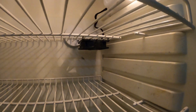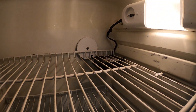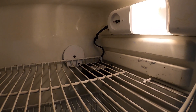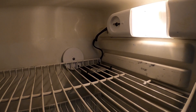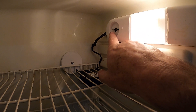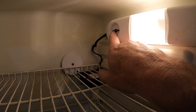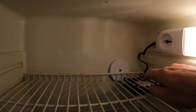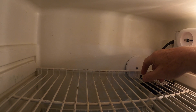I've also got a little circulation fan in there which helps stop ice build-up on the back wall. The temperature sensor for the electronic controller is sitting here, so as mentioned it measures the air temperature inside the fridge, whereas the original thermostat was actually measuring the back wall temperature.